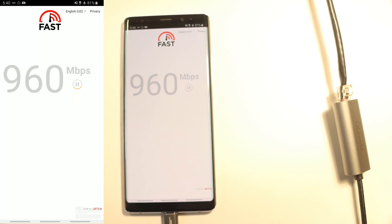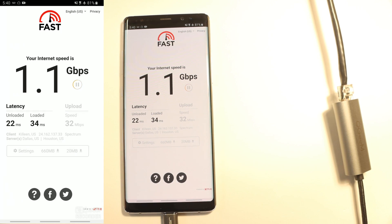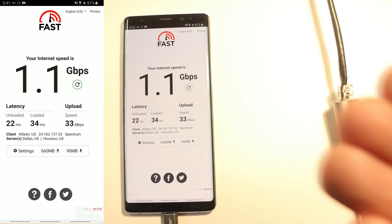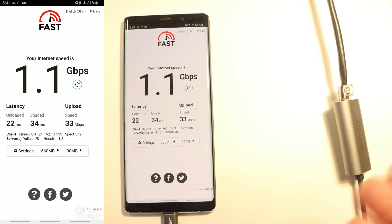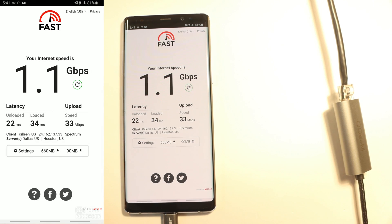As you can see, this gives the phone one gigabit per second speed. What are you going to do with this? You can use it as a network tester, or if you're a gamer you'll have a lot less latency on Ethernet than on Wi-Fi. Wi-Fi is a half duplex technology — it can only send or receive data at one time. Ethernet is full duplex, meaning it sends and receives simultaneously, which reduces latency significantly.